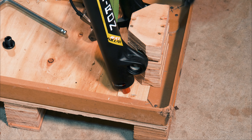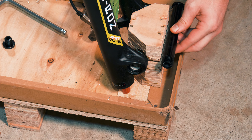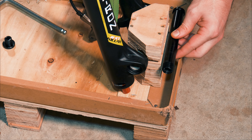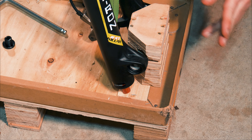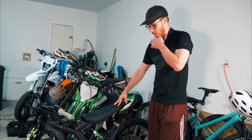I would really like to see a different packaging solution for this. A couple other people have really had issues — stripping the threads, not knowing about the reverse threads, just having a really difficult time pulling it out. Here's what I learned: because of the bike's weight pushing down, the axle rests on the bottom of the bore drilled through the wood block, so it gets bound up. If you can have a helper pull a little weight off the bike so it's more floating, then as you spin the ratchet you can work it out much easier.